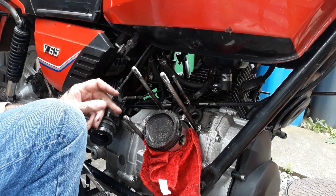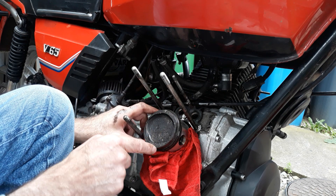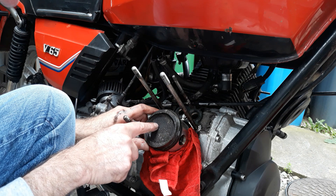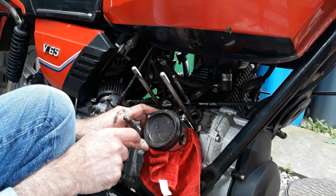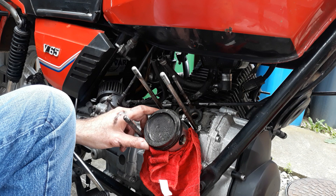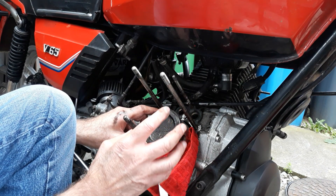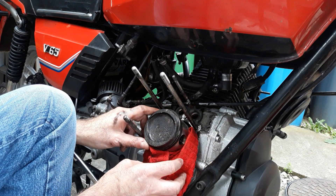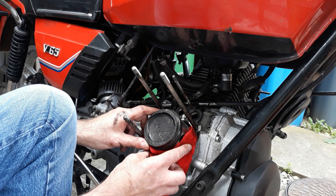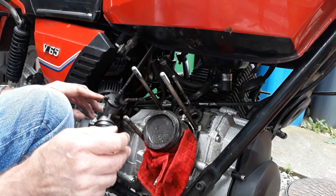It's the piston which is in question. The piston has had damage — you can see where the exhaust valve head broke away and it's stamped into the piston here, and also over here. There is some damage, and the question is whether you'd get combustion leakage from these areas. I have a feeling we may need to replace this piston. I'm going to remove this piston and take the piston, the cylinder, and the head to a Moto Guzzi specialist to ask their opinion on what remedial work needs doing to get this cylinder and engine back in working order.